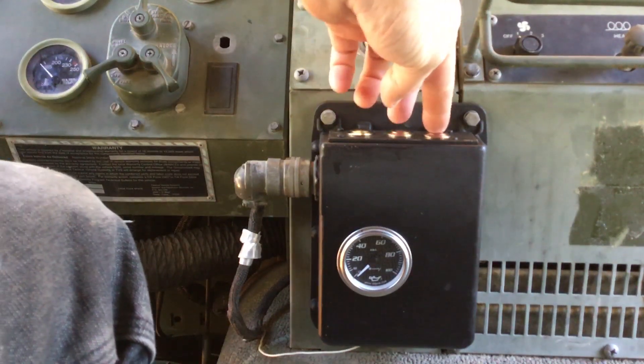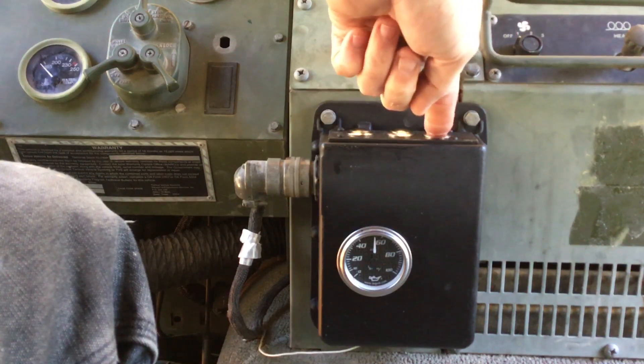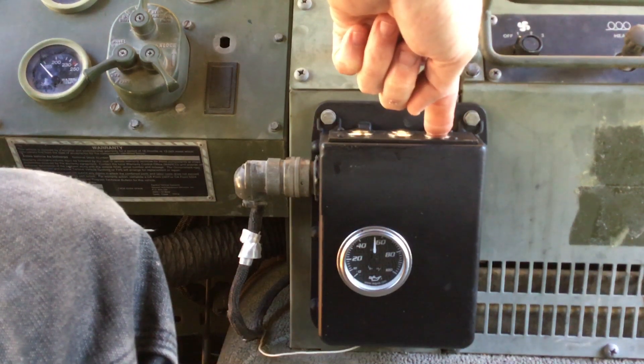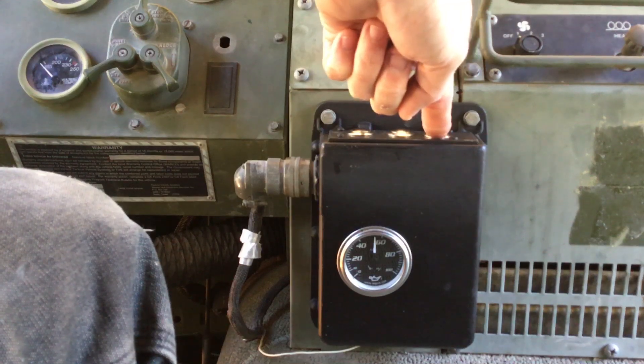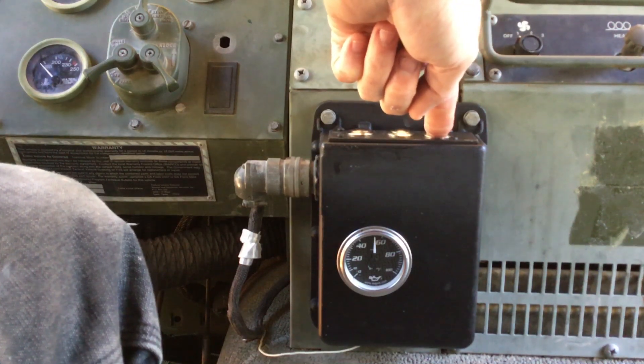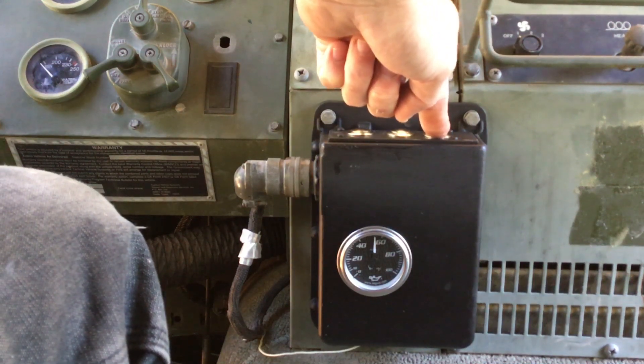In order to check pressure, press control, momentarily press supply to give a little shot of air to open the air valves, and the gauge will stabilize at your tire pressure. If you have one tire that's low, it might take a little while to settle out once all the tires equalize.